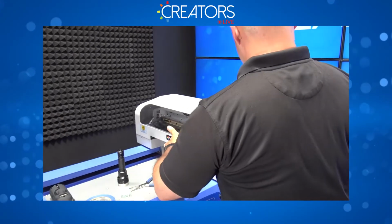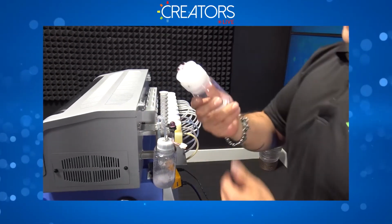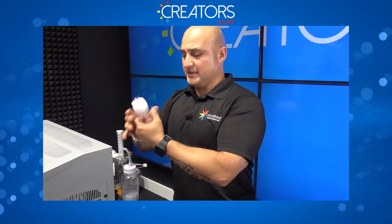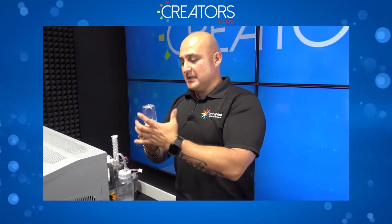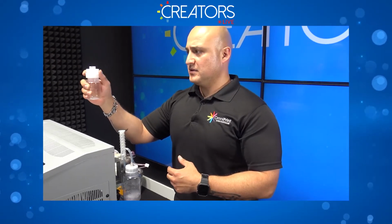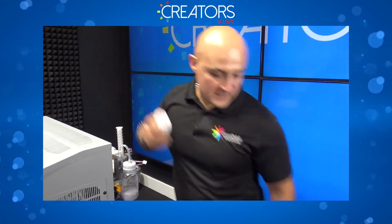Right. I would like to talk also about these bottles back here on the capping cleaning system. I've noticed some machines have this bottle right here super crushed and collapsed. The reason that happened is because this cup, the lid or adapter, is super tight. You do not want to have this cap super tight, because that's the reason this bottle collapsed. To make sure it's properly tightened, I always like to grab the bottle like this, and use my index finger and my thumb to untie it and tie it back. If I'm able to untie this bottle, then it means that it's properly tightened, and it will not crash.